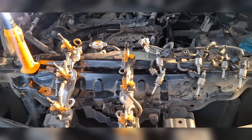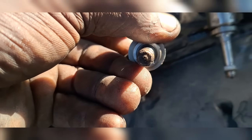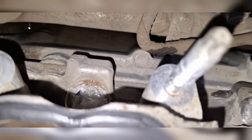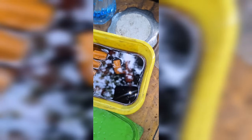Here are all the nozzles. These are the port fuel injection nozzles — you can see how dirty they are with carbon buildup on their faces. These are the direct injection nozzles — they also have carbon buildup on their tips, you can see how very plugged they are. This carbon buildup could be causing our issue. We'll also look into the spark plugs and the air induction system.